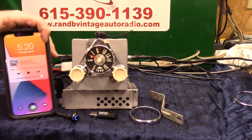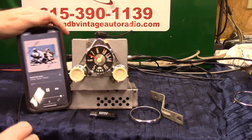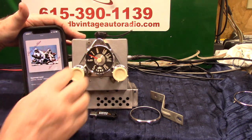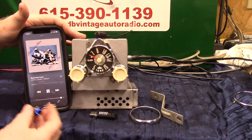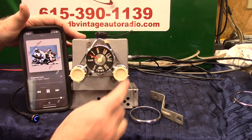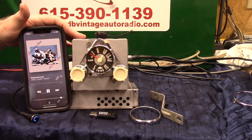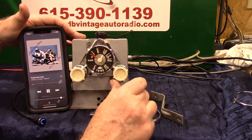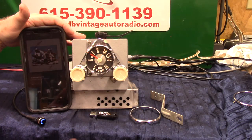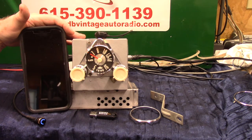You've got a mic that you can plug in and run anywhere in your cab to get it closer to you. We're going to do a voice command — you can hold this button down and bring up your phone to call home, look up a restaurant, whatever your smartphone is capable of doing, by pressing the knob up twice. You can advance your music here or with the button — press once to go forward, twice to back up, repeat. Use your tuning knob. Phone not in your hand, full control of your music. When a phone call comes in she'll announce it — press the button once or turn the knob up one click to answer. When you're done, let the phone hang up by itself. Bluetooth overrides everything the radio is doing.